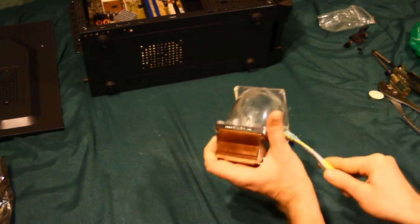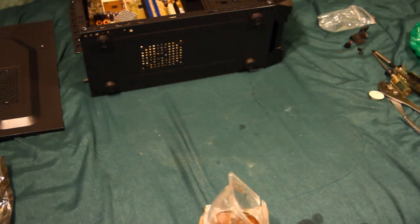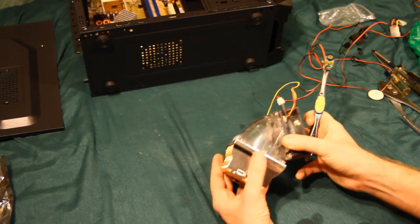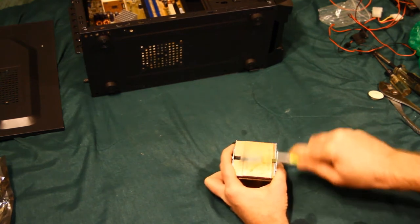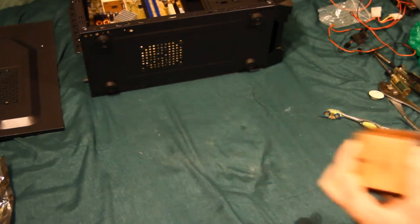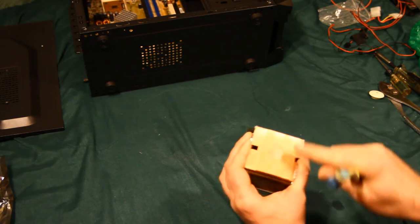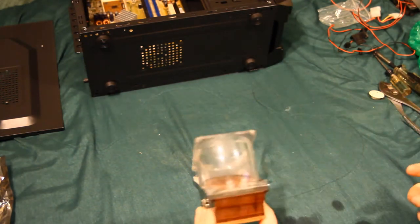While I'm at it I can clean the inside — there's some tape on here. I remember why there's tape: I didn't have screws long enough to put this fan in, so I ended up taping it on. I wonder if we'll have to do the same this time. Clean off the old thermal paste. I actually lapped this at my parents' house back in the day — on the bench buffing wheel in my dad's shop, so it's a little shinier than normal.